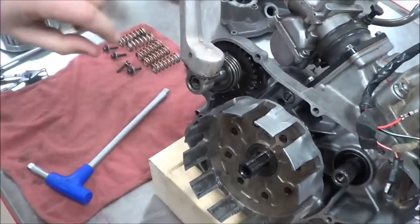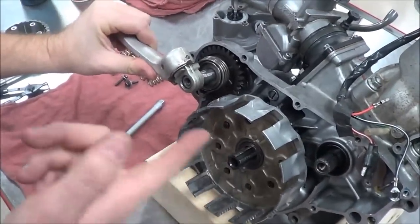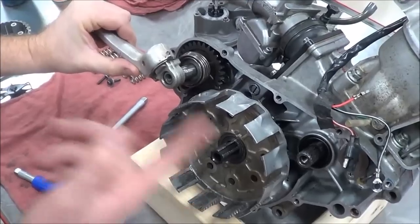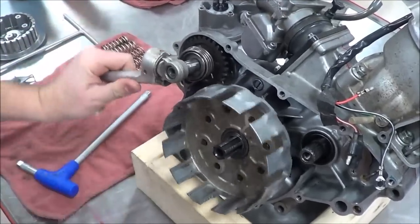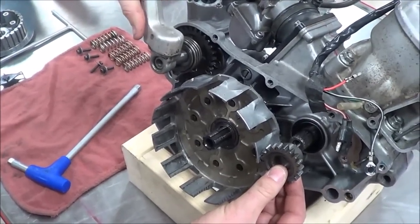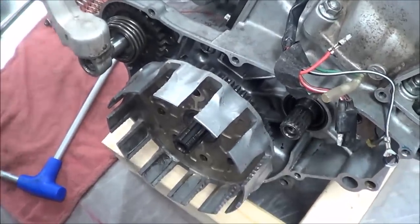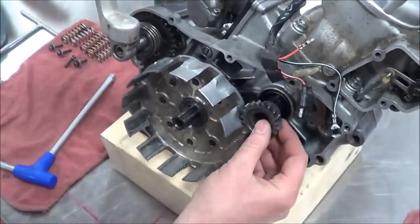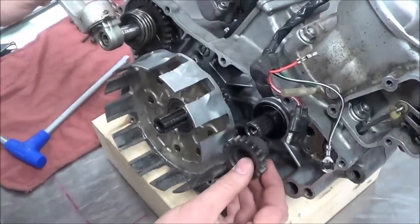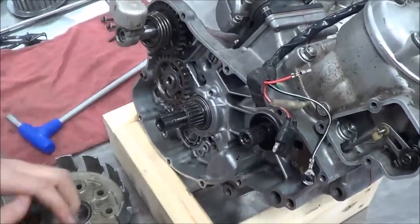What I'm trying to get you guys to think about is the idler gear went clockwise, which it always drives the gear next to it opposite, so it's going counterclockwise, which means it's going to drive the engine what direction? Forward. Clockwise and forward. Make sense? Okay, so this one here is going to require the primary to be fully on before we do that too.